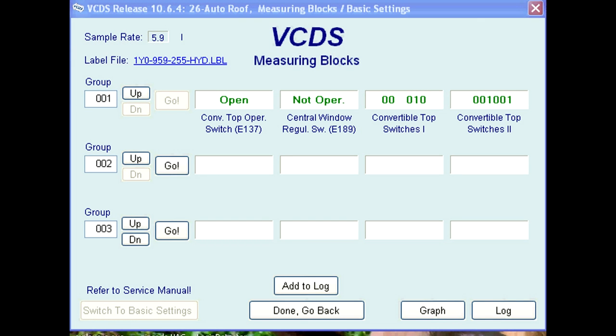Now let's look at how VCDS can help diagnose one of the most common issues that the new Beetle convertibles have — a faulty F171 switch. As you've seen, the F171 switch sends two different signals: a closed roof and an open roof. The F171 is two different micro switches, and the one used for the closed roof signal can stick, so that the roof electronics is still getting a closed roof signal even after the top has opened beyond 12 inches. If the closed roof switch is still active when the open roof switch is triggered, the roof electronics will stop operation of the top.